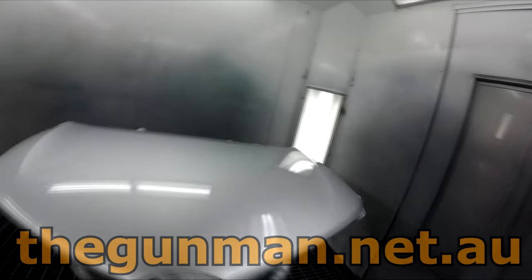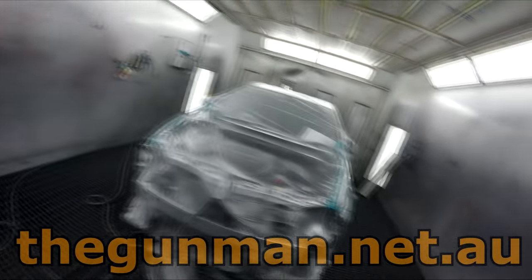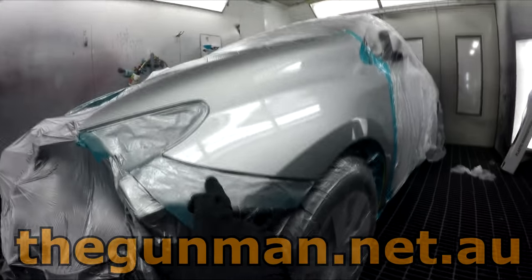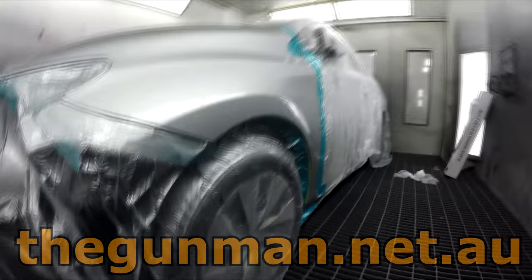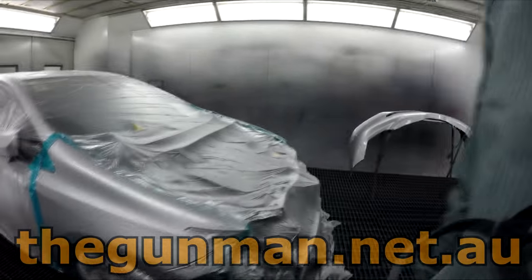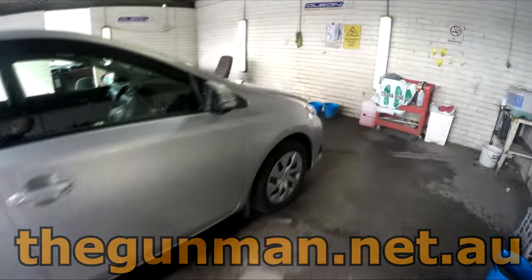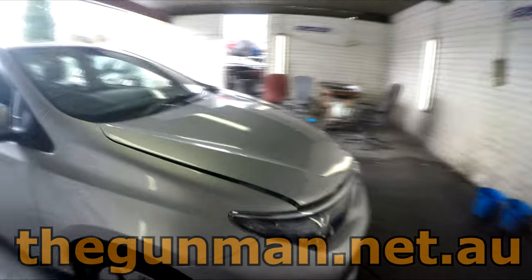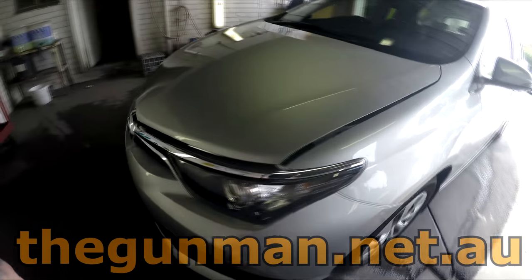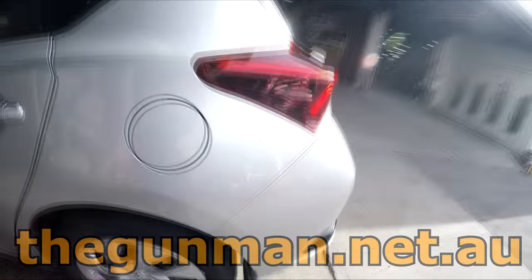I decided to put two coats on the bumper — you can go with one coat, but I love these little Corollas. I probably could have mixed up 250 because it's a smaller bonnet than average. Really happy with that color — blended out nicely and there's no real mottle in that bonnet, it's laid down quite nice. Clean the gun out, give it five minutes while it's packing up, then bake for 40 minutes and Bob's your uncle. Here's a quick look at the end result — a car I'd definitely be happy to drive around. Now you've seen this video, get out there and paint some. Thanks for watching — this has been another Gunman production, goodbye.